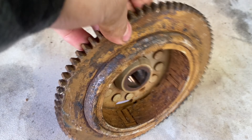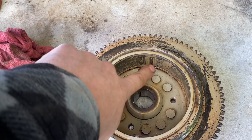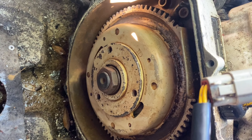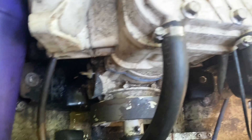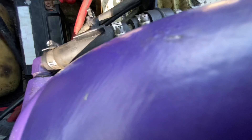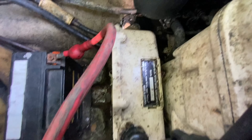My buddy got these 1995 Sea-Doo SPXs in various parts and conditions. He's got a third one - we're making two out of the three. Quick, easy, getting them out of here, getting them running. So that's the lucky one getting put back together. This one is being scavenged for parts because we have a nice one that blew a motor. We're going to steal the motor out of that one, put it in the new one. That one has stator problems - we're going to put a stator in that one. All in all, should be interesting.